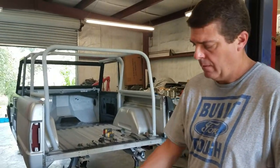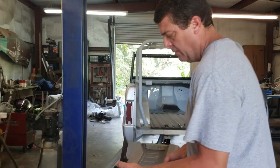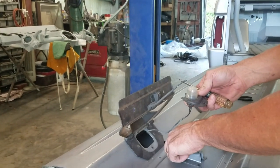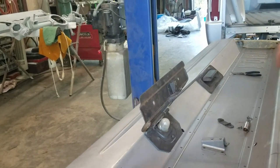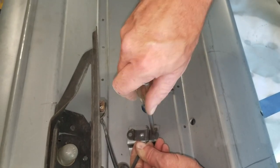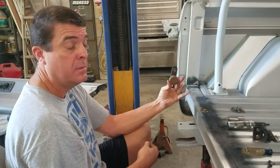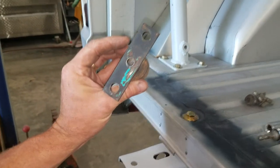We don't have to have our taillight and tag holder put on yet, but I just want to go ahead and put it on so I don't lose the parts — keeps everything in one place. Basically it's just how it came off: you have a couple of screws. We'll get a rubber grommet and put the light back through the hole. And then the spring and the rubber bumper that goes in. You'll start off with one of these in place — and there's that Caribbean turquoise. Pretty cool to see some of the original color.